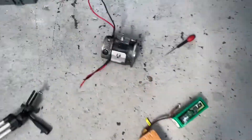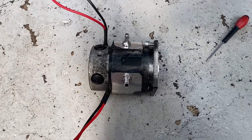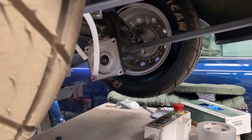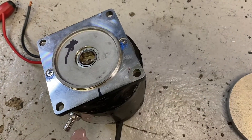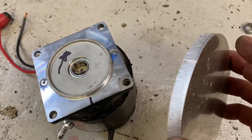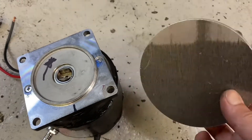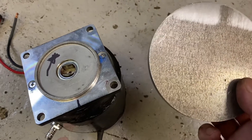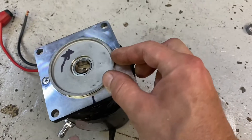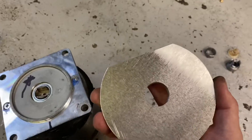Got the motor out, so I suppose I'll make a mount to fit the brushless motor on there. Part way through making the adapter — I had this laser-cut disc, a few of these which were used for the front hubs on the Jaguar. The motor has this raised section shoulder, so I've started on one of those.